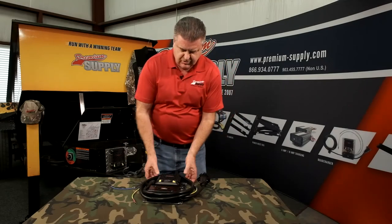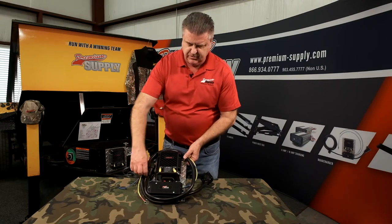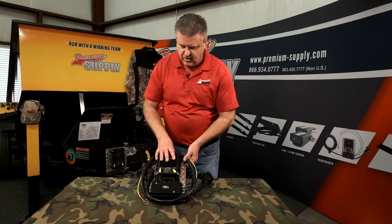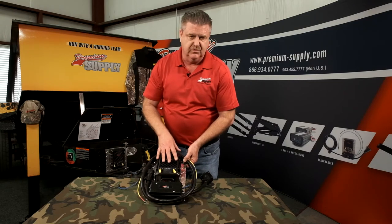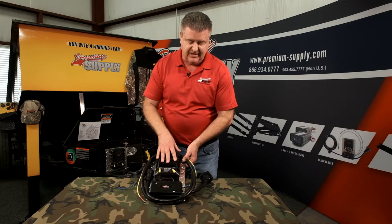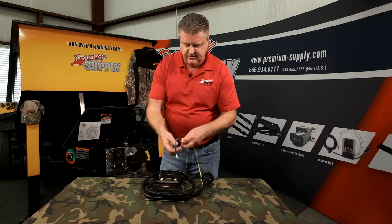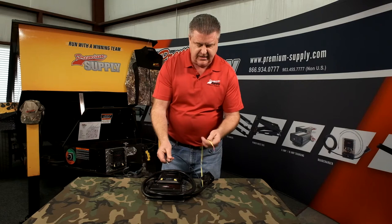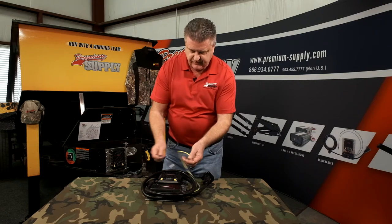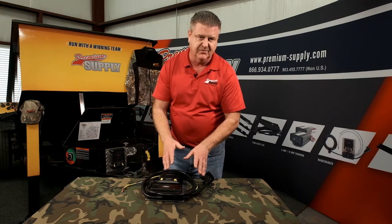This is our road charger. This unit allows you to work with your standard seven-way and it puts out up to 20 amps when you're going down the highway. It only works when you have power at your seven-way. It also comes with wires — these two go to the negative side, this one goes to the positive side. It has a temperature sensor watching the battery and making sure the temperature is not too high. The higher the temperature, the fewer amps it takes.